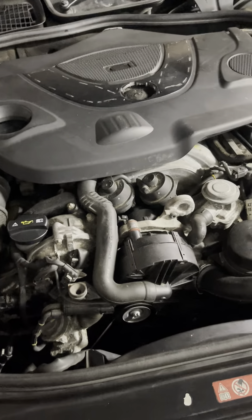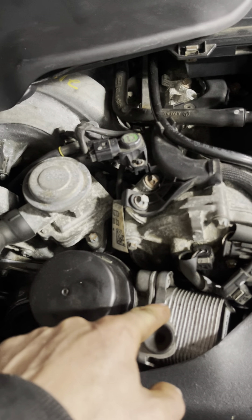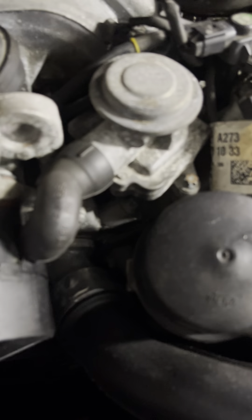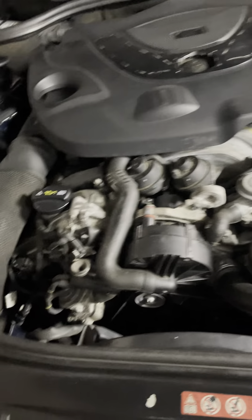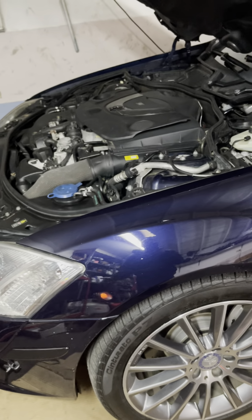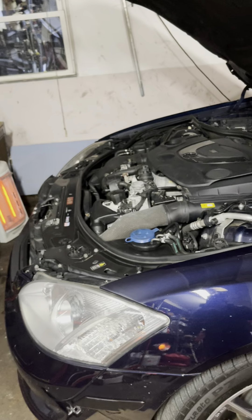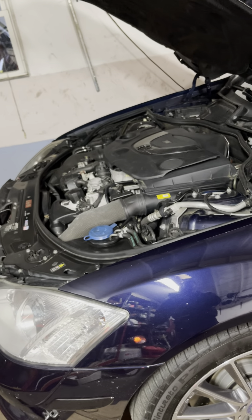On the old engine I also had to do the oil cooler gasket and the oil housing gasket, which is deeper in there - they're known to leak over time, that's pretty normal. Other than the air struts, it's about the same amount of maintenance as an E-Class. Other than having two extra cylinders on a V8, there's not much difference between this and an E350 of the same year.